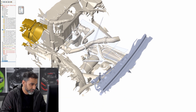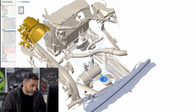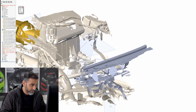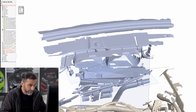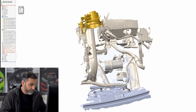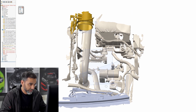I always look for easy places to mount the system. The obvious places in this area are down there — you've got the rubber mount which is where the stock airbox locates, and you've also got two openings at the back where the stock airbox sits. We still need to find a place for the ECU to live, which won't be on top of the airbox. This is the opening where the intake will have to breathe cold air from. We'll get started on the design — I'm going to try and see if we can use our patented venturi style housing with a sealed duct. We'll try and put that in place, work out the ECU placement, and hopefully come back to this process in the next video.